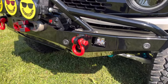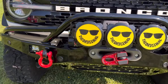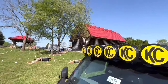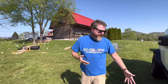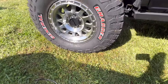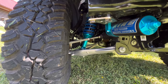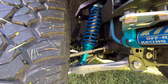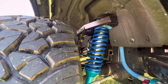The build starts with the JCR Off-Road Vanguard bumper with their pre-runner tubing. We've added a Warn 10S winch and KC lights everywhere — in the bumper, on the bumper, on top of the windshield. We've done Method 315 wheels with a zero offset, General Grabber 35-1250s, with Baja Kits billet upper control arms. In the back, we have the Baja Kits billet lower control arms on order.